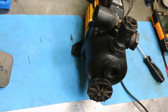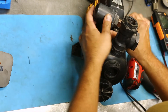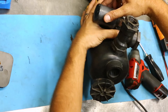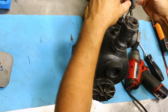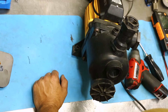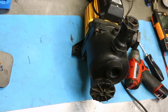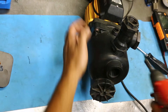While we've got it on the bench, you'd be mad not to open it up and have a look to make sure everything in the front is how it's meant to be. I'm going to take the pressure switch off here. These pressure switches can occasionally give you a bit of grief, but they're very cheap — about 30 or 40 bucks and simple to fit. It goes without saying, we're working with 240 volts here, so if you're not comfortable or not qualified to work with 240 volts, don't do it. So we'll pull this nose off.